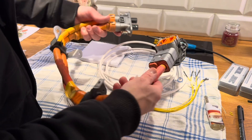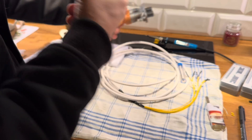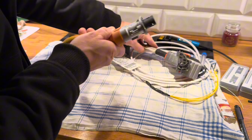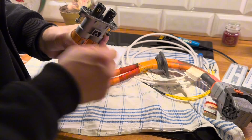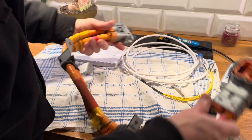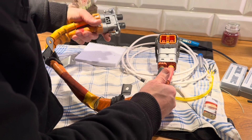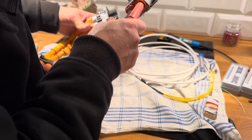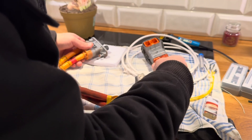Here is the high-voltage cable and connectors. This end will go into the car — we're not going to have any need for this one sadly. It's a really nice connector but I cannot use it because I don't have the other side of it. This end goes into the battery, sitting like this and screwed in place, and there is also a rubber gasket on this side so it will be completely sealed up when screwed onto the battery. My plan now is to cut the wires and solder on some solar cables — I haven't really decided, but since this will just be temporary for a while, I think I'll go with the solar cables and do it the right way with heavier gauge later on.